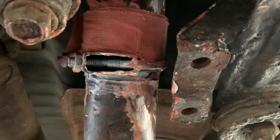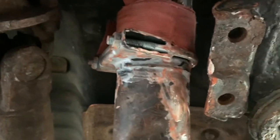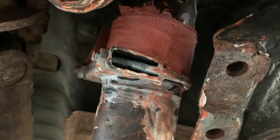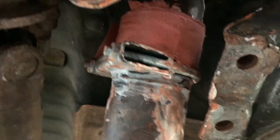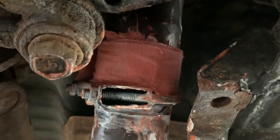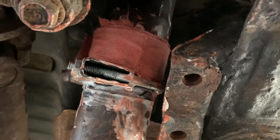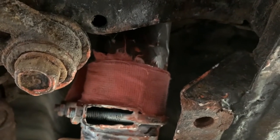As I mentioned, this is just to get it through MOT — this exhaust will be coming off. I'd never do this as a permanent fix, but you're not allowed to have exhaust blowing in the MOT test. A bandage and paste will seal up the hole: slap it all on, cover it up, give it 24 hours to cure, then heat the engine up slowly and the heat finishes it off. It fixes the leak to pass the test — it's not a pressurized line. The exhaust gas just flows from the engine out the tailpipe and this makes sure it doesn't blow out around your diff. When and if it passes the MOT it'll be getting a proper exhaust system.